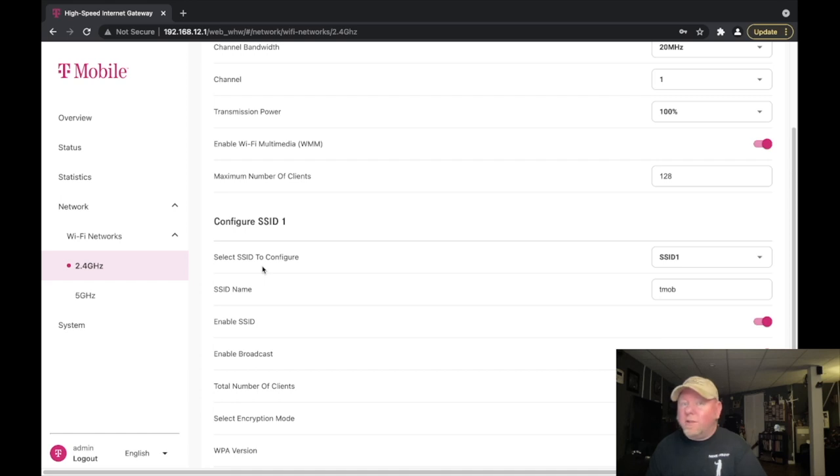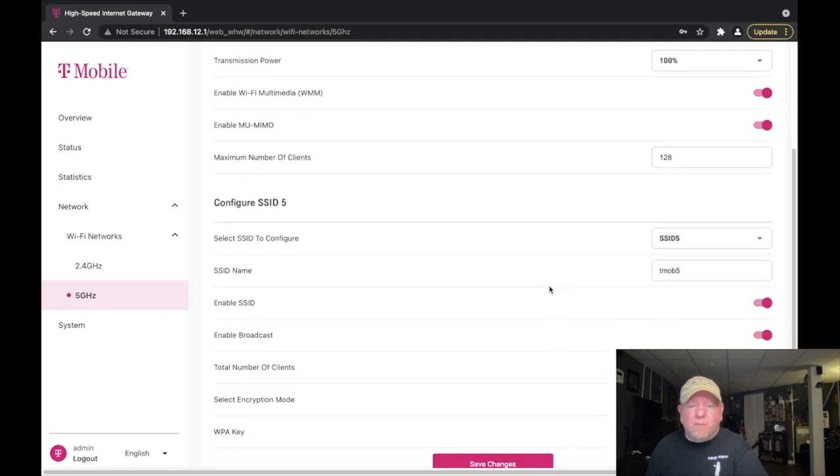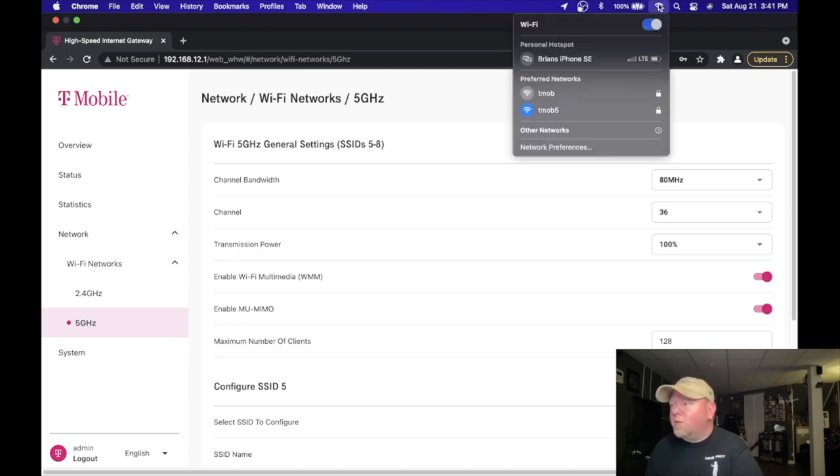What I've just recently found out is when you go to the 5 gigahertz band, you can rename that band. I named it 'TMOB five.' That way when I go to a device I can choose to connect to the 5 gigahertz band or the 2.4 gigahertz. All you have to do is change the name and save changes — wait a second and it's automatically saved. Then when you go to connect to WiFi you can see two different networks to connect to: your regular one and your 5 gigahertz. It's a little bit faster with the 5 gigahertz band for sure.